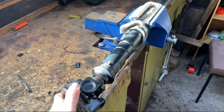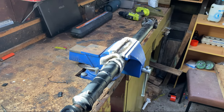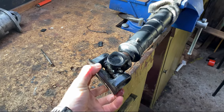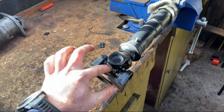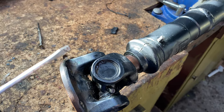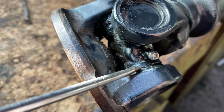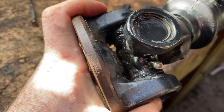I'm actually converting it to a solid rear setup. You can get a kit that converts it to a normal prop shaft like you would find in a Defender or a Range Rover Classic — this one here is actually off a Range Rover Classic. I'm going over it and looking for play in the Hardy Spicers or Universal Joints, and also checking the general condition of the seals. So far it's looking pretty good.